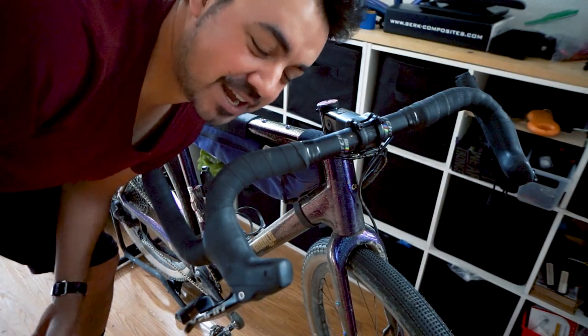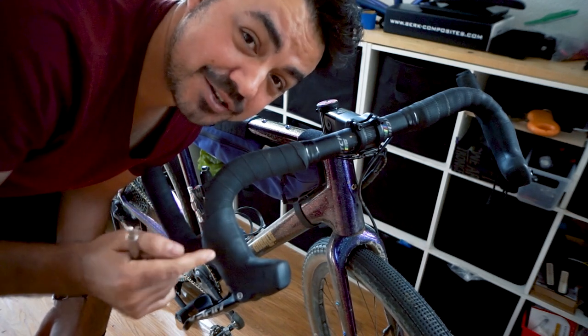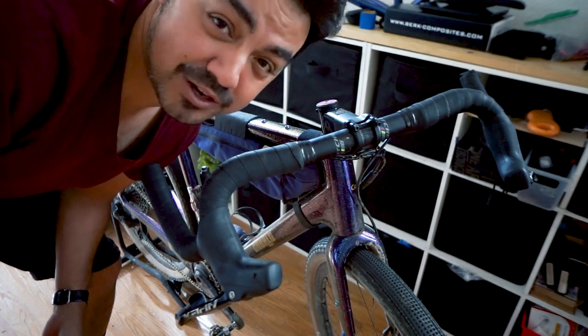I was really dumb — you want to keep your bars kind of stiff so you can take your bar tape off easier. I'm going to mark my shifter hood position on here so if I ever use these bars again, they're automatically set up. Little pro tip in case you want to try swapping bars.